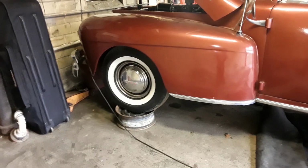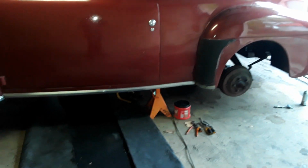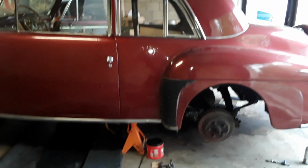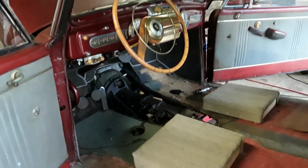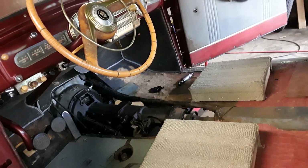Of course, I've got it supported up on a set of wheels, so it's sitting fully loaded on its suspension in the front, and a pair of good heavy jack stands in the rear. And I got the car fairly level, slightly down in the back, ever slightly, but not much. And then we will use the engine hoist cherry picker to put a strap around the transmission and lift it up, slide it back once I get the axle out, and then take it right out the passenger door. Very much like pulling an engine out of an old early style Econoline van. Not much dissimilar to it than that, and I've done quite a few of those in my day as well.